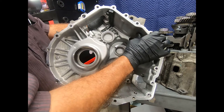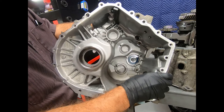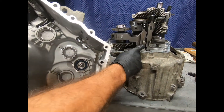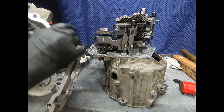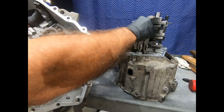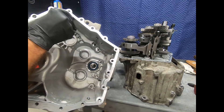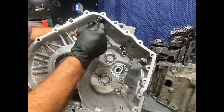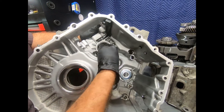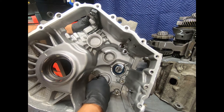Here we see the ball-in-springs going against the four shift rails — these go against the detents of the four shift rails. As I put this together I've got to ensure that the shift rails are going to line up properly and go into their different ports. This is simply an oil weir — what it's doing is catching oil that's slung and using it to lubricate this bearing. It just flows right down into the bearing cavity, and here we see the other bearing cavities.